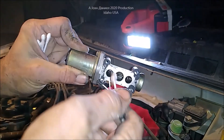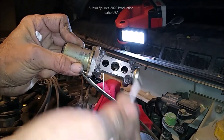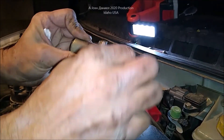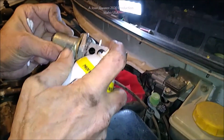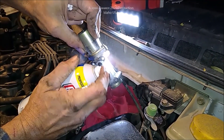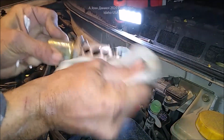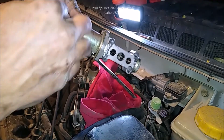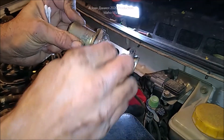Because of the buildup, we just want to get all of that cleaned out. Use as many q-tips as it takes to get it cleaned out — reach down in there deep and get it all out. Sometimes it won't run right off the bat until it sucks the loose stuff out as it's firing up. Sometimes I got about five miles down the road before it cleared up. Just shake it around and spray it at the angles of the valve that allows airflow, until it comes out clear.